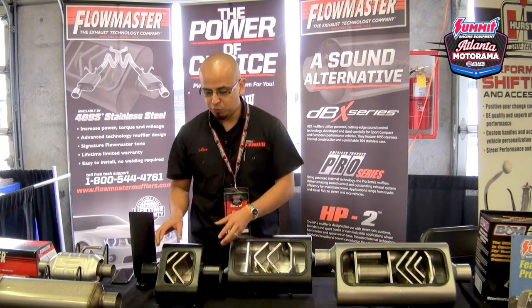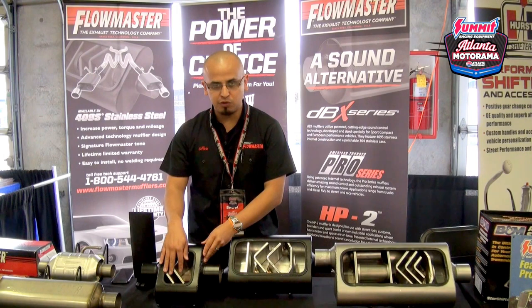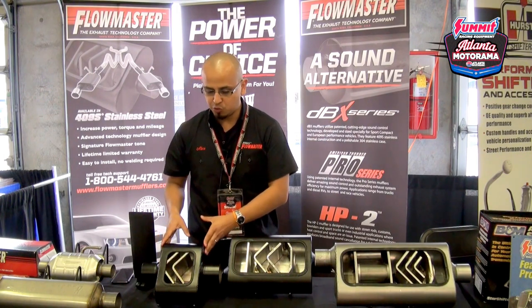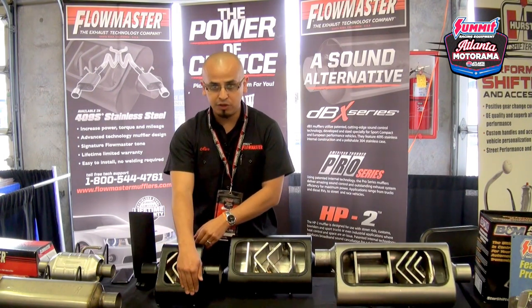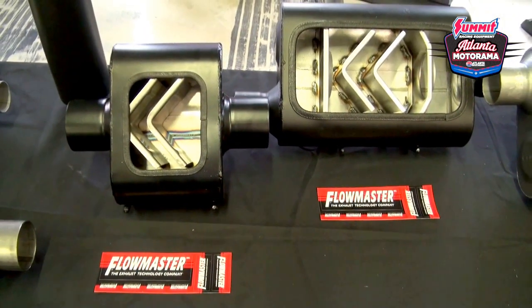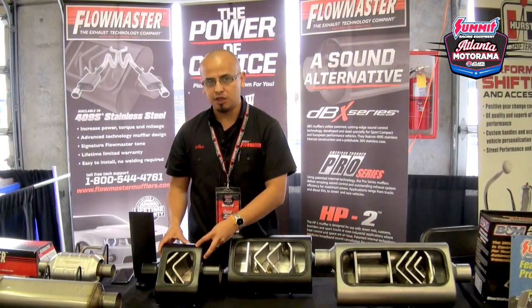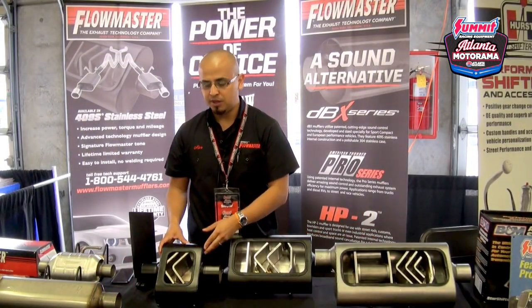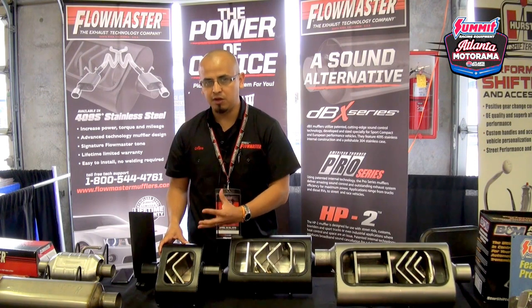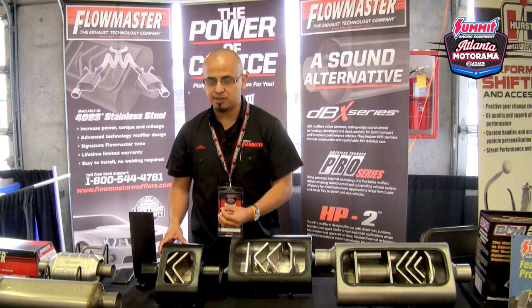The Super 10 One Chamber is a full stainless steel constructed muffler which features a power chamber with two deflectors, a smaller shorter case which is also narrower in width, and we offer it in various configurations and diameters. This is something I'd only recommend to the customer looking for an aggressive, extreme, noticeable tone — not something I'd recommend on a family vehicle or an SUV, especially if you're not looking for interior resonance.